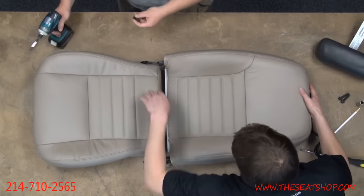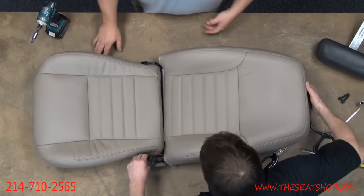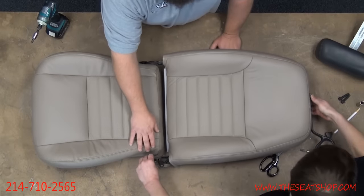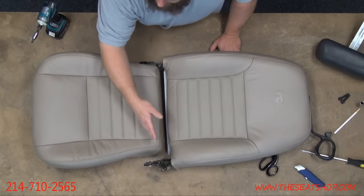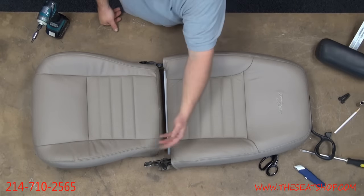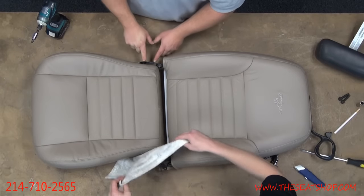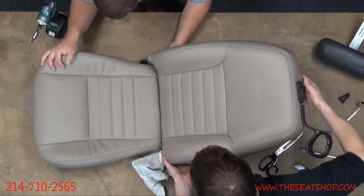Now we'll line this up. This is our Torx. It's going to be that T45. I'm just going to roll that in. Now when you're putting it up, a lot of times you may want to take a rag or something you can put on the inside of where the frame is here, so you don't nick anything in here. We've cut them before. So a lot of times we'll drape it with a rag there while you're moving around to get this thing set. So let's see.